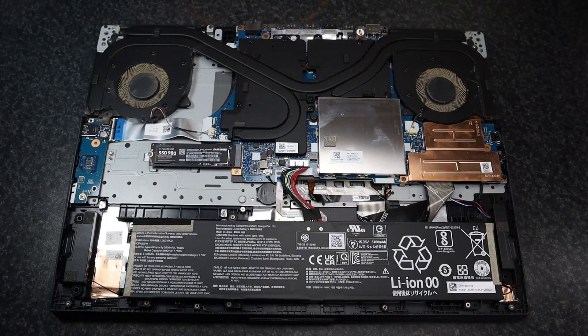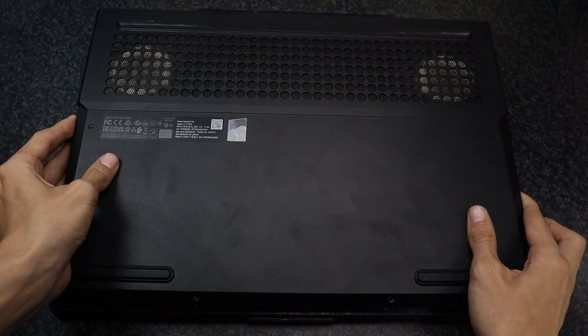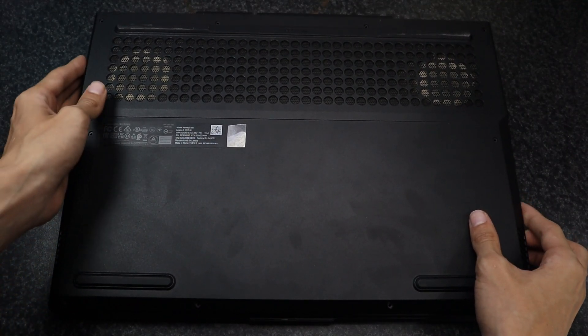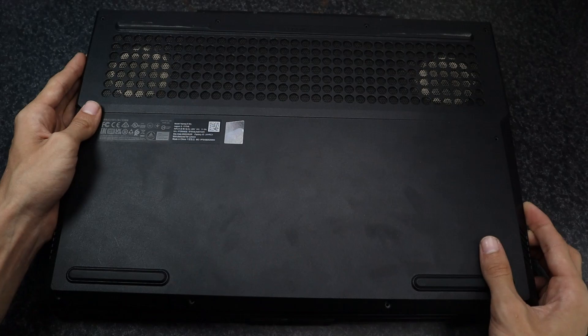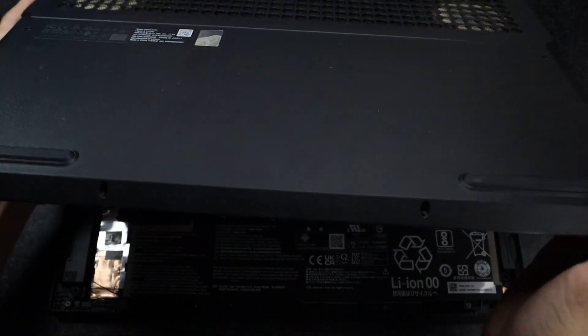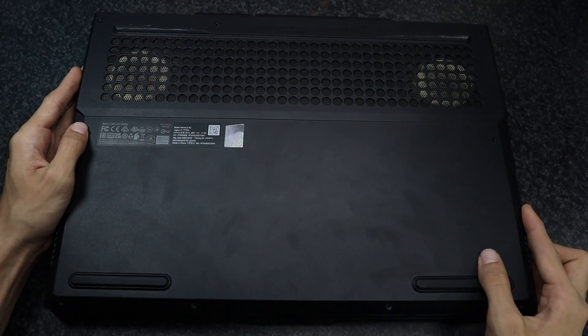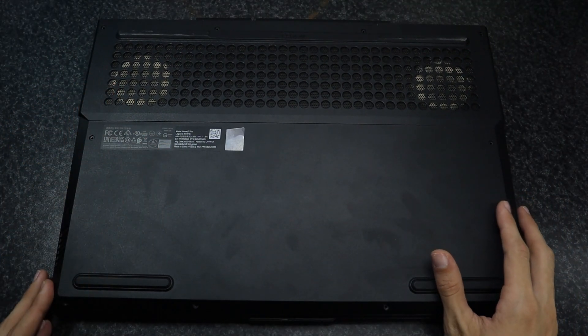And that's the whole process. Don't forget to connect the battery again and then close up your laptop. Now you can turn it back on and see if the drive is recognized. If not, don't panic — most new drives aren't partitioned yet and partitioning a drive should be a 1 minute process. I have a Dutch video about this and will probably make one in English too. I will link a tutorial in the description for the meantime.